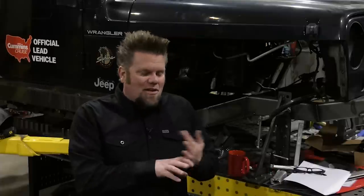We solid axle swapped the front, did air shocks all around, four-linked the back, and used a divorced Suzuki Samurai transfer case with six-to-one gears. I put around 40 inch tires on it — I believe it was Toyota axles up front, possibly left the Datsun axle in the back. Painted it tan, bobbed the bed really hard, and took it wheeling. It was a fun truck because the little diesel engine didn't have enough power to break anything, and the proven drivetrain — Toyota axles, Samurai transfer case — just worked well.